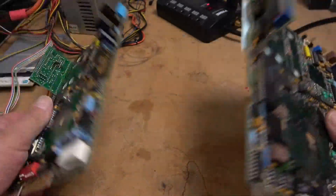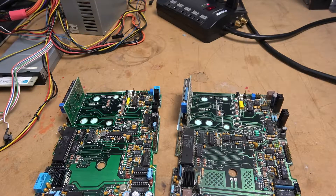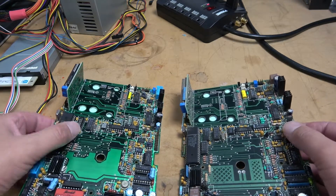Each drive I've numbered based off of what board I pulled it off of and what I did. It turns out that the drive I mentioned that would spin up but wouldn't do anything — if I pulled the control board off of the 1050 that wouldn't activate the heads, and put that on my 1060, it works perfectly. I was able to fdisk, format, do a surface test, and it had one bad block on the drive. I was like, that is a success — that is pretty awesome.